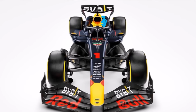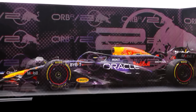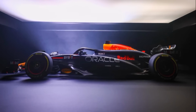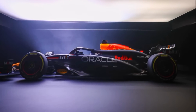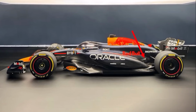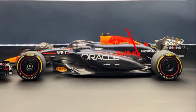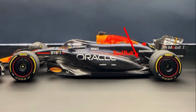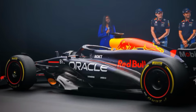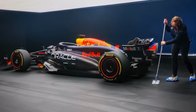These have to comply with the R50 rule of the bodywork, so these sausages are pretty big, and Red Bull keeps them straight for quite long, to keep the losses inside. At the back, we have a pretty steep slope to create more downwash and to exit the losses between beam and rear wing, so they don't hit anything important. And our old friend, the so-called suspension opening, is still there. At the rear wing we can see the detached flap, and of course we couldn't see the diffuser and the floor edge was covered. So Red Bull developed their concept further in a pretty aggressive way and copied features of Ferrari and Mercedes, while everybody else copies Red Bull.